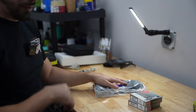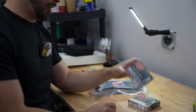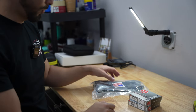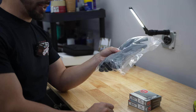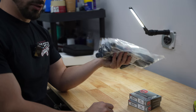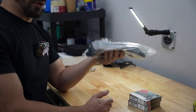One of the good things is the car already has fire sleeving on there for protection against burning up from the headers, so I'm going to go ahead and reuse these. The NGKs are basically what's going on here — they're already pre-gapped, but I'm going to match the gapping that is currently on the vehicle since it was tuned prior to my ownership. When you ask around online what everyone's running, you still have a large batch of people running the more obvious MSDs, the AC Delco guys, and a lot of people running the Accel 9000 series — their ceramic series meant for high heat.